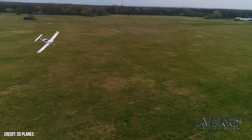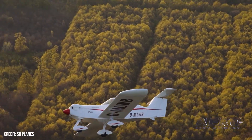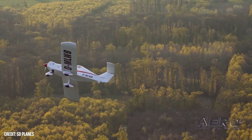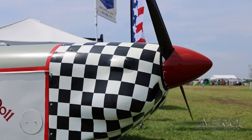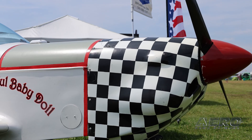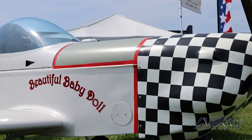Talk a little bit more about the overall performance of the aircraft. The tank is a nine-gallon tank. With this engine, it's burning one to one and a half gallons an hour, which is ridiculous — it has quite a decent range. With me in the plane, it stalls clean at about 55 and with flaps at 45. Our specs are 39 to 49, but that's with the standard pilot. It's very comfortable to fly. When you trim the nose down for level flight, you can take your hands off the stick. It's not a plane that requires a lot of attending.